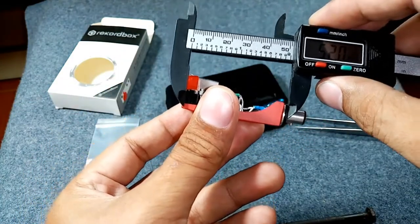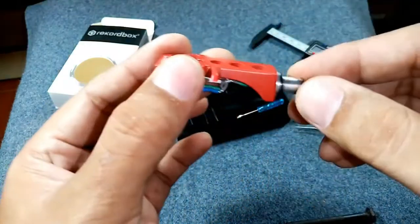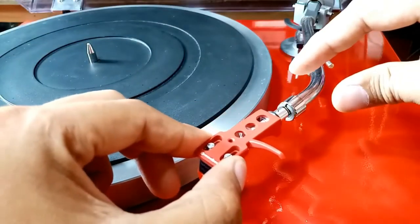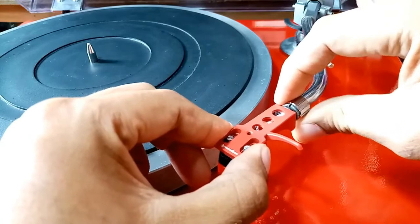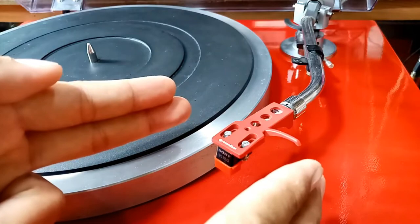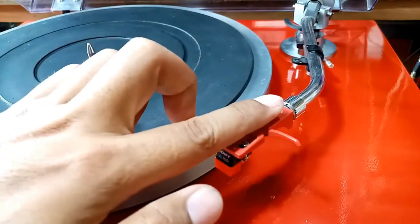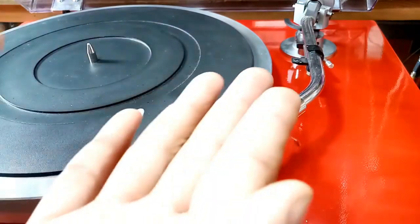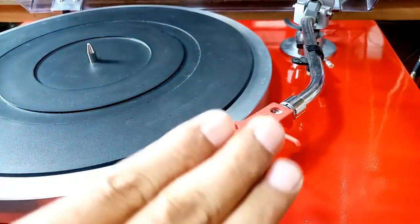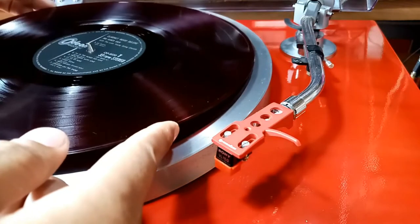Let's double check — it's all set. Now I'm going to mount this cartridge onto my turntable. This is how to mount it, guys. Then check the vertical and horizontal alignment. Your headshell — this plane — must be parallel to the plane of the platter. The headshell must not bank to the right or bank to the left; it must be flat and level.